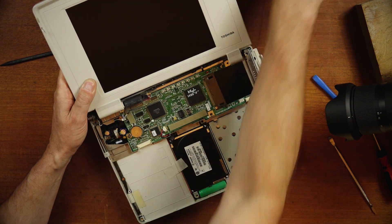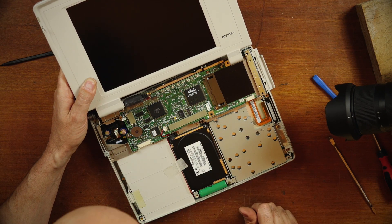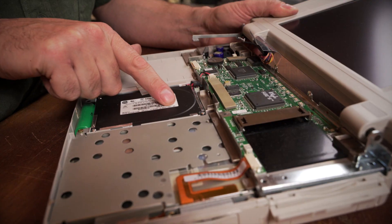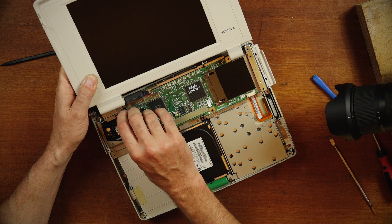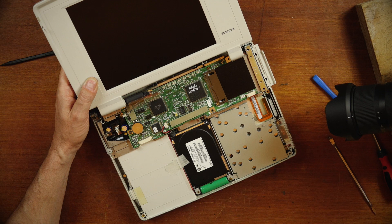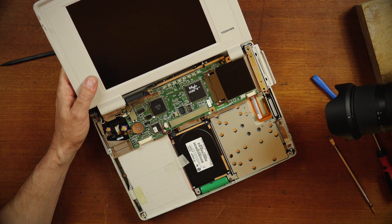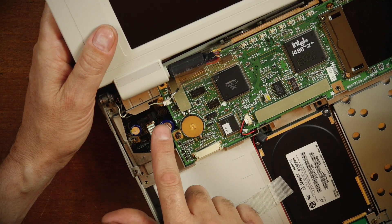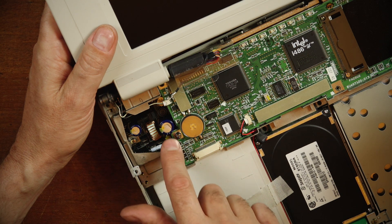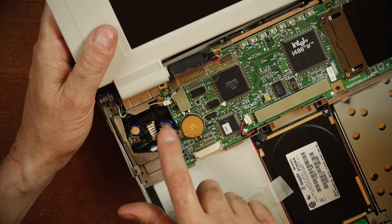That shield is off. It definitely is a 486 SX machine. And we can see here on the hard drive it says 200 megabytes, so it should be a neat little game machine if I can get it working. I'm not sure what kind of screen it's got — probably just a black and white screen, but until we get it going we won't know. This area here definitely looks like the power circuitry, so we'll see if we can get down in there, remove these capacitors, test them and replace them, and see if that fixes our issue.